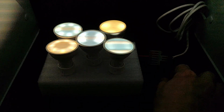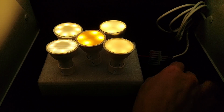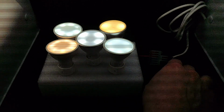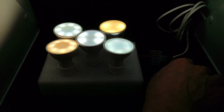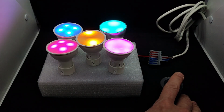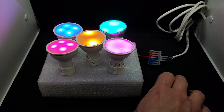A few notes. First, the good. Such control is completely autonomous and will work even with a non-working Zigbee2MQTT and turned-off coordinator. Now the specifics. When controlling, the modes are not synchronized but simply receive commands for change. For example, if the bulbs were operating in different modes, they will turn on that way, and you'll need to adjust the brightness and color temperature to the maximum and minimum to align all values.